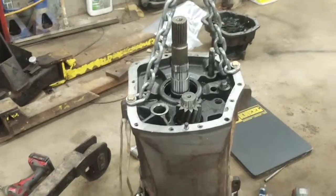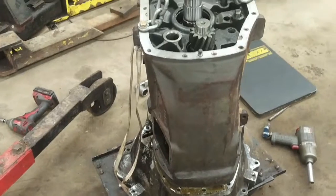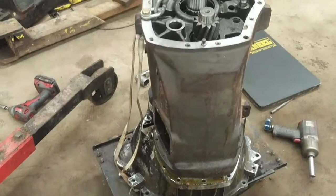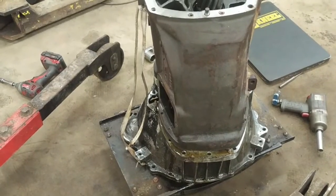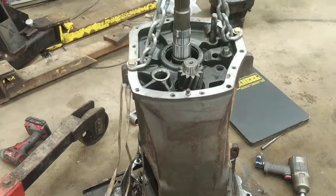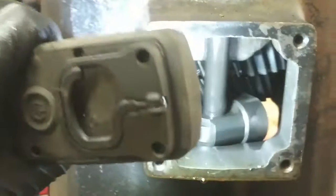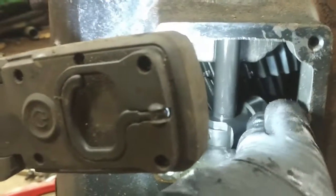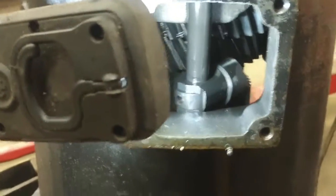You need to use a cherry picker and a chain to lift the case off — that cast iron case is pretty heavy. Once you get it suspended slightly, tap the aluminum housing and the case will start to lift off. That's going to be interesting to put back together. You also have to fish out the roll pin from the shift fork — knock this roll pin out and turn the shift fork cup inwards so that it clears the housing. It doesn't come off until you pull the transmission completely apart.